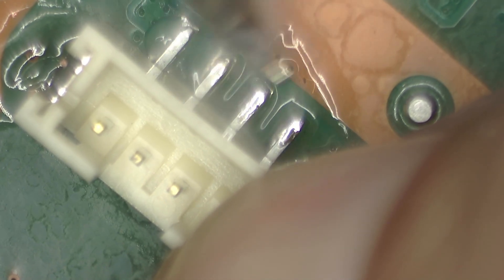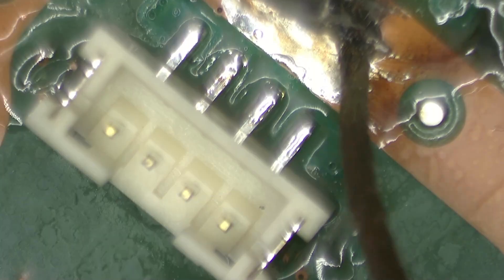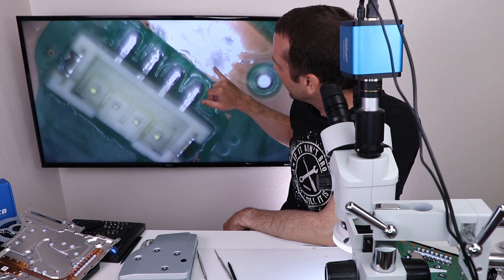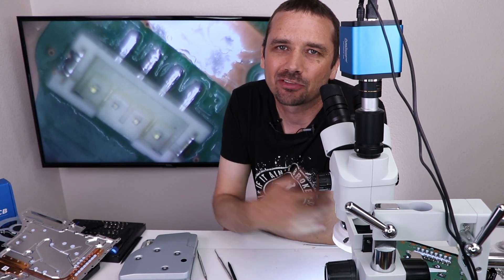Well, it's fine. Now we have both connectors fully soldered on and secured to the motherboard correctly. You can see I got some solder on this ground plane right here — that's no big deal. I cleaned most of it up with some solder wick, but it's not a big deal to have a little bit on there either, so that's nothing to worry about.